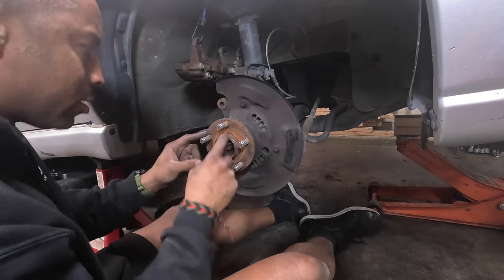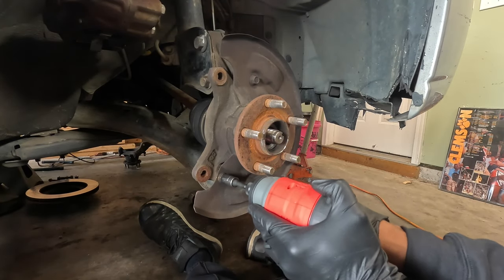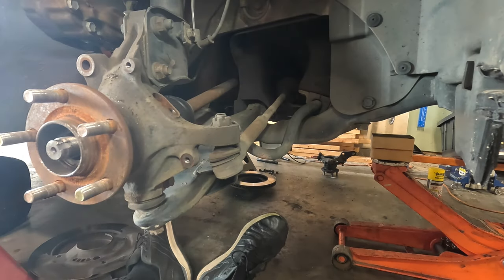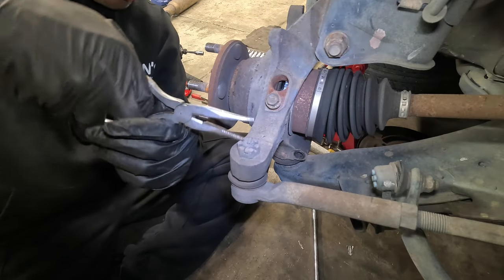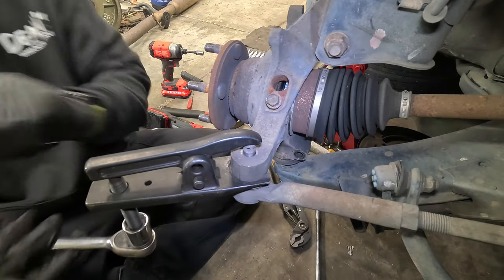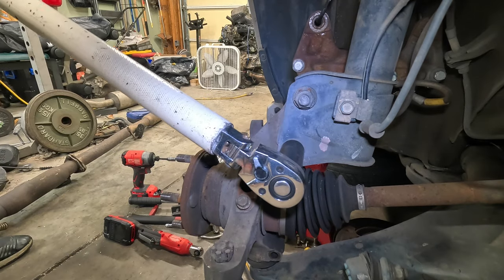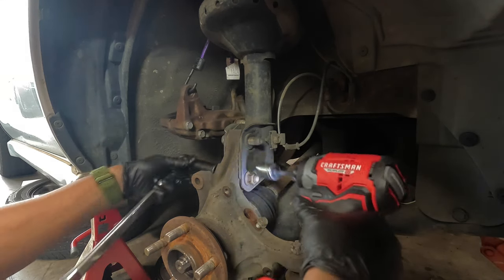This bearing doesn't look like there are any issues. Maybe if I take the axle out and give it more freedom, but it doesn't seem to be this bearing. I'll take the shield off first — it doesn't necessarily have to come off but it'll make things a lot easier. Then the ABS sensor gets hung out of the way. I'll put links to the special tools and kits I use in the description because they make this job a lot easier. The top bolt has a washer; the bottom one doesn't.